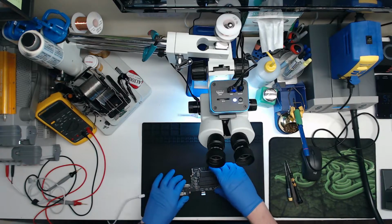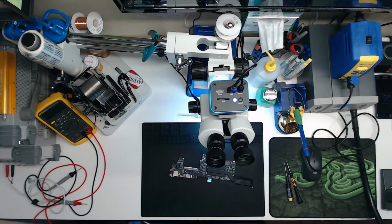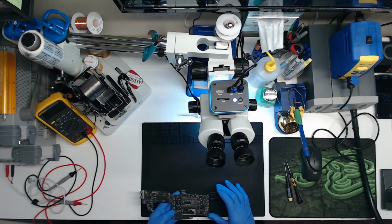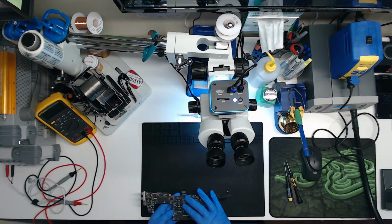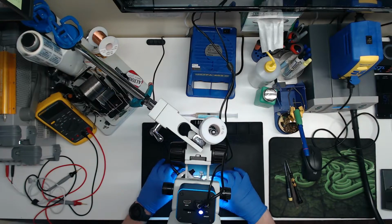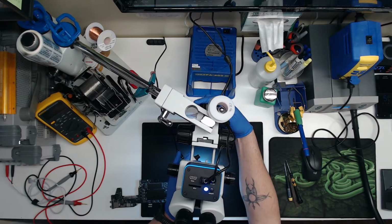All right. So there's not going to be any soldering going on in this video, but we could still troubleshoot. See, almost 20 volts, 280 milliamps, which is what it'll do if it's not hooked into anything else. I don't see anything corroded on this board, to be honest. It's really clean. The only liquid damage I found is towards the audio board, which makes me believe that the audio board is probably faulty. There are some hazy little shadow-looking things around this board, a little bit, but nothing I would consider liquid damage. In fact, it looks like this board may have been ultrasonically cleaned, which I'm willing to wager could be it.